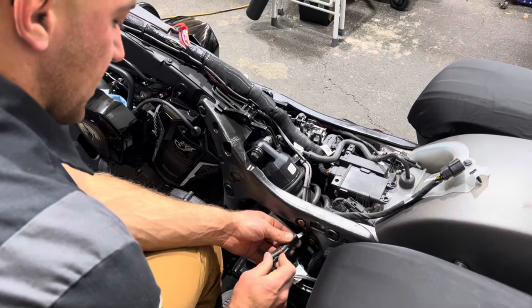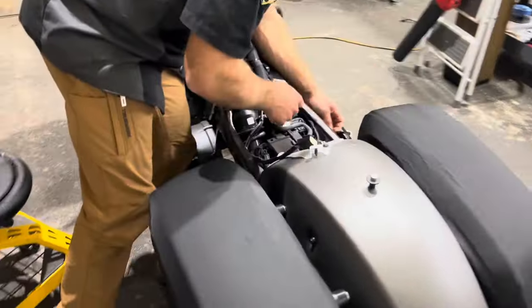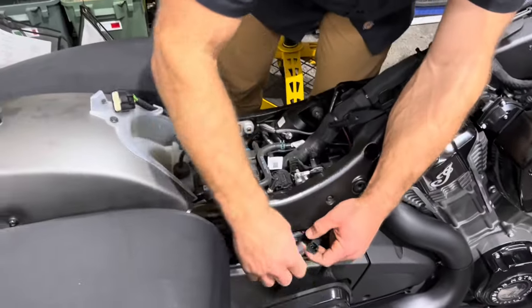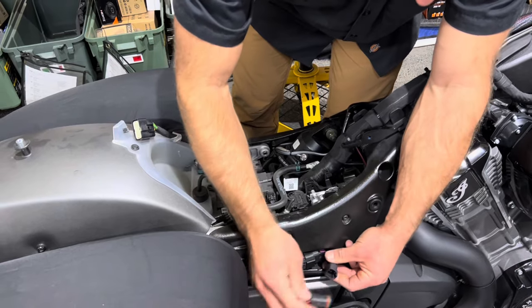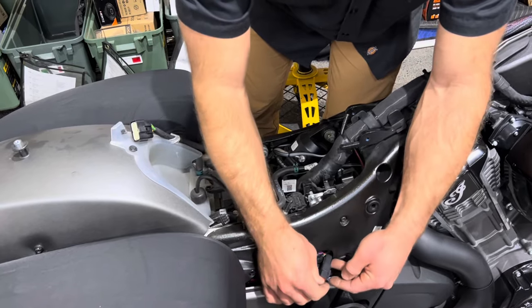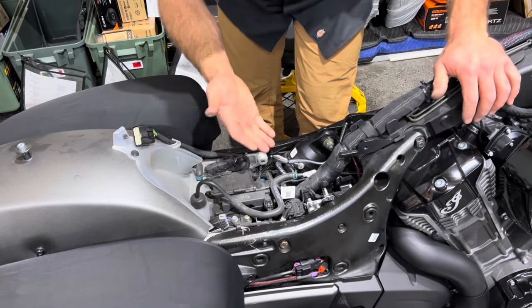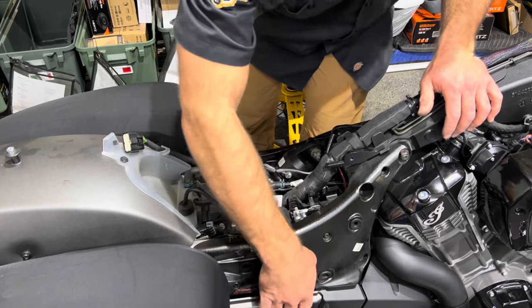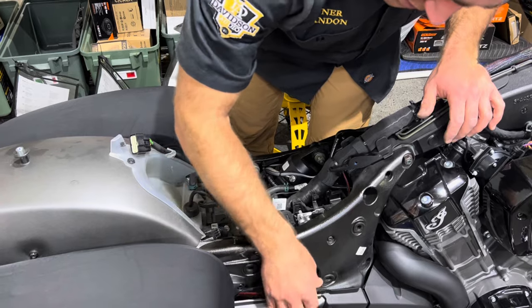And there's one more thing I want to touch base on this other side. Like we were saying, when you make your connection here, you can take your bags off here and here, then you can plug that back in. This will get plugged in here. And when you go put your side cover on, just take this connector and push it right there. It's not going to contact the belt. That's why I had you leave just a little bit of room here. And then when you go to service it or take the bag off, just pull this connector out, disconnect, disconnect, and you're good to go.